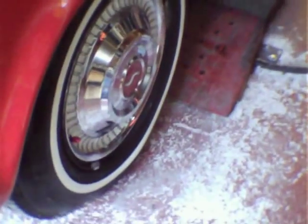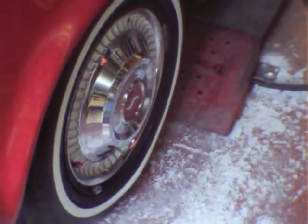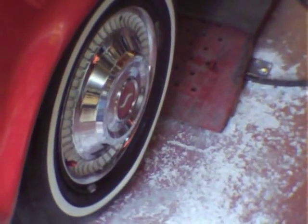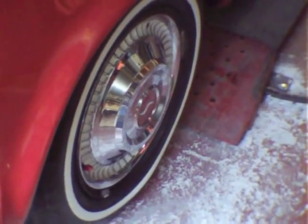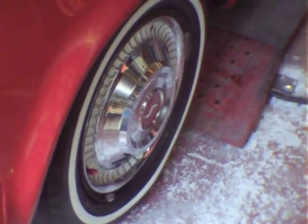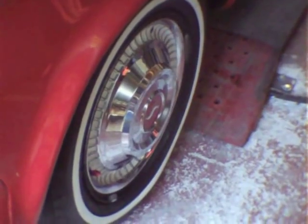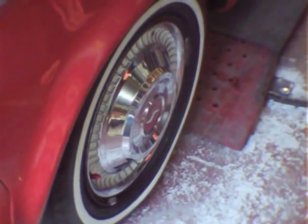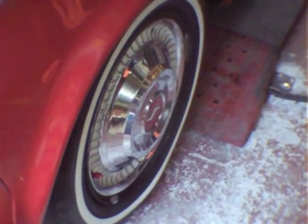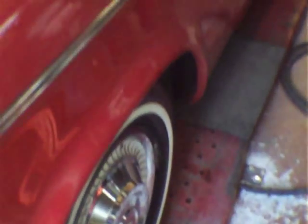Here's another shot of the wheels up front. These are Jeep 7-inch wheels — 15 by 7s — and they're a nice deep wheel. The original wheels were only four and a half inches wide, not much wider than a Harley motorcycle. To get them on the front I had to use one-inch spacers, which work out really well and push the wheels out to the size of the car for a better look. The only downside is on a sharp right-hand turn in a driveway or parking lot it does rub a little bit, but we can live with that.